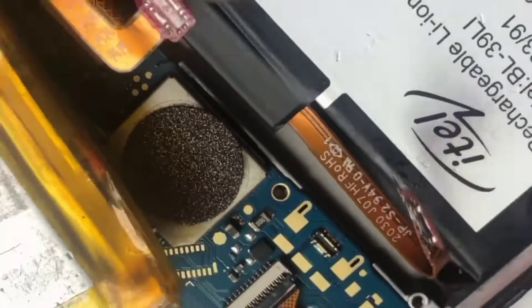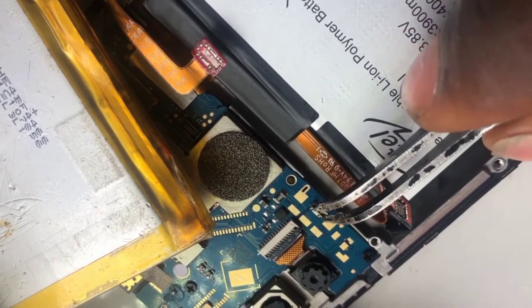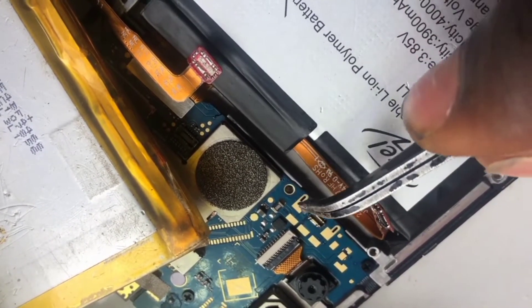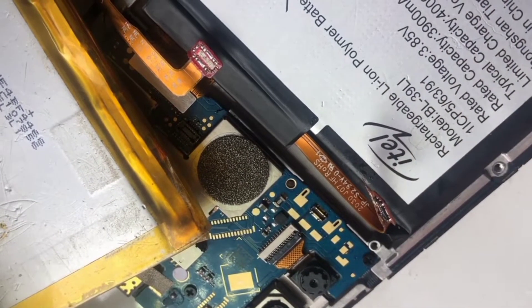This tiny leg close to the negative side is what we call the BSI — the battery status indicator. You can jumper it directly to the board, or remove this clip completely from the board, or track where the clip is connected to the board and jump right from there.